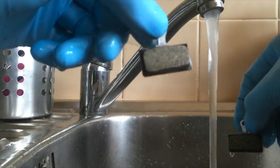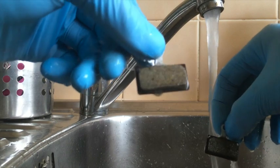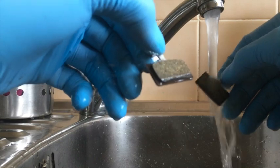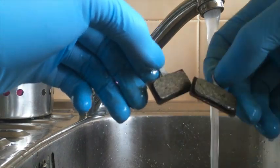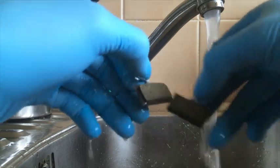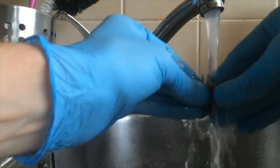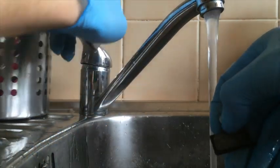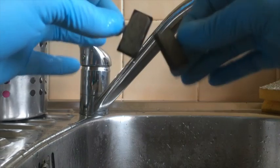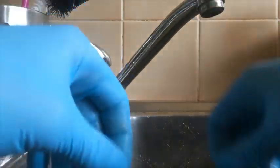You can notice now already — that colour, before it was like a greyish colour, but now you can see different colours in there, like gold specs. That's basically the parts of the sintered material that's in the pad, and obviously that's what you only want contacting with the disc, not the greasy bit. So just keep doing this, keep rinsing them under hot water and washing them, keep reapplying the soap, and do that until basically the water starts running clear. Then just dry them on a clean paper towel and you're good to go.